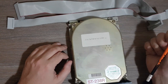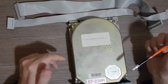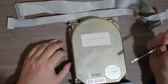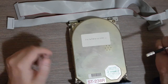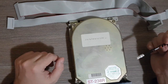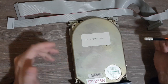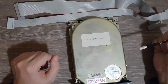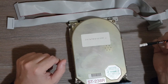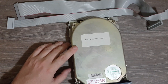On the other hand, if you take an MFM disk and use it with an RLL controller it may not work reliably. However, this difference is not that the disk is built differently — it's just that an RLL disk is certified to support RLL encoding. So if you have a very high quality MFM disk you could potentially use it with an RLL controller, but it's not certified and may cause data loss if the disk quality isn't high enough.